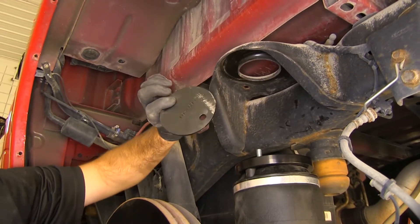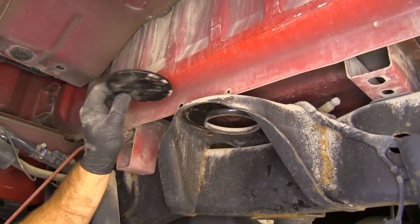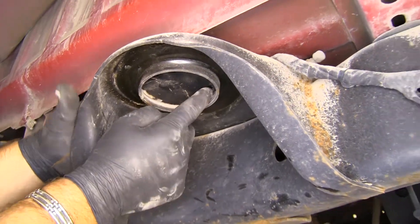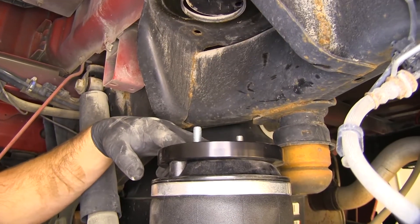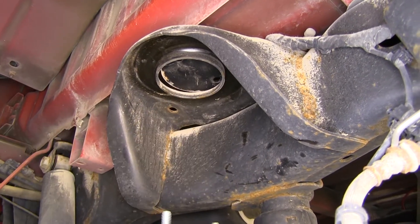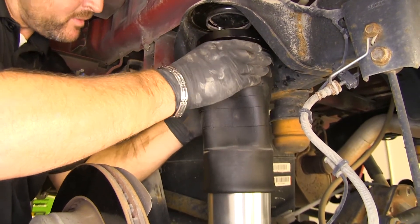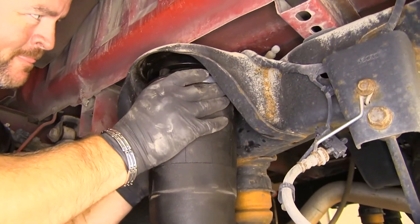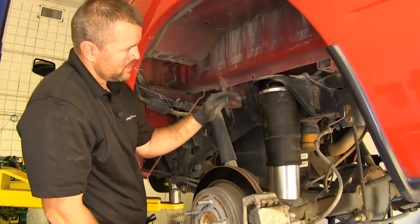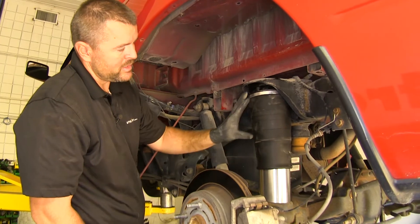In your kit you're going to get a plate, and this top mount where your spring was — this plate is going to slide in on top of it, right inside or just above the hole. Your two double-sided bolts are going to go up inside of this hole through the two holes in that plate. Grab your bag and raise it up, line up the two holes, and you're going to have two flange nuts. Hand tighten those for now, but make sure before you tighten them all the way down that the bag is not twisted in any way.